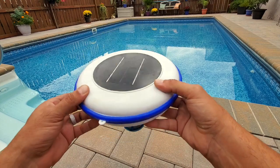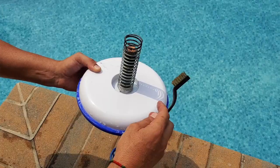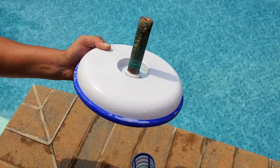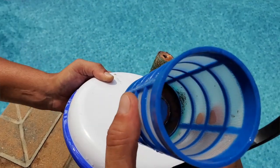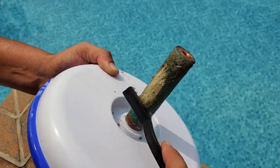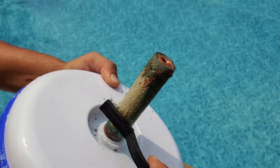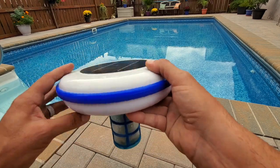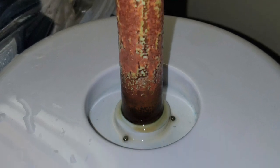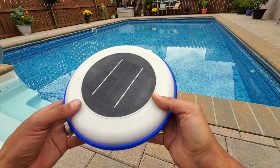As far as maintenance on this actual unit, fairly simple. There's a little wing nut here, plastic. You end up just taking it apart, pull out this little screen housing, and inside you'll expose the actual copper rod. After a while of use, it does begin to get oxidized, and this kit does come with a metal wire brush, so that you can go ahead and scrape the oxidation off of the tube, exposing the actual copper, so that this unit can go ahead and do its job.